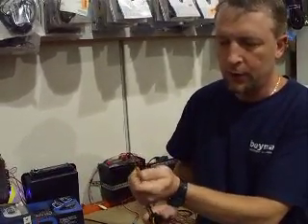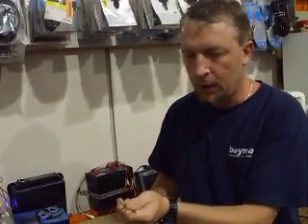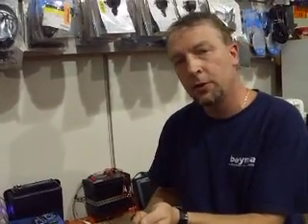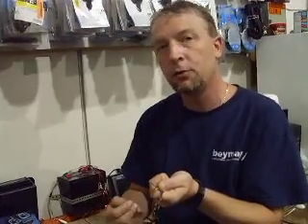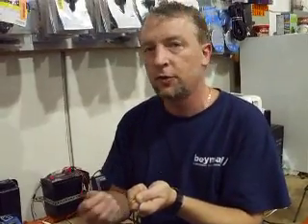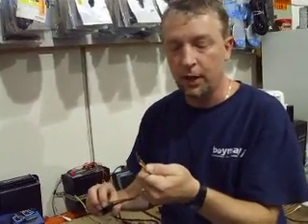What I'm going to show you how to do today is pretty simple, and a lot of people ask how to do it. It's basically if you have an alarm, a keyless entry, remote start, whatever, and you have negative outputs from your system and you need to invert them to positive for a GM door locking system, some Fords, etc. — this could be your best friend, and it's a must-have.